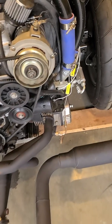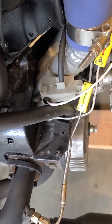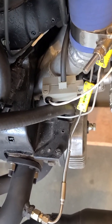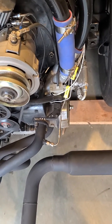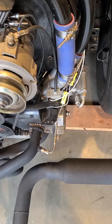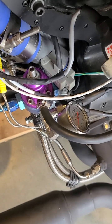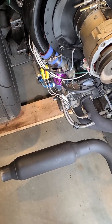I have these little pickups — those are actually made for tachometers. But I had to put a little circuit board inside of them because I was getting such crosstalk across the lines, so I had to do some signal conditioning inside there. That's one of them, and there's the other. I've got them on cylinders two and four, which on a Volkswagen are opposing in the 1-4-3-2 firing order.